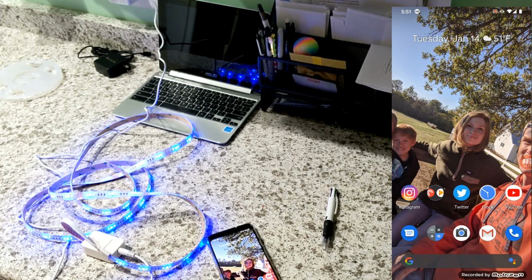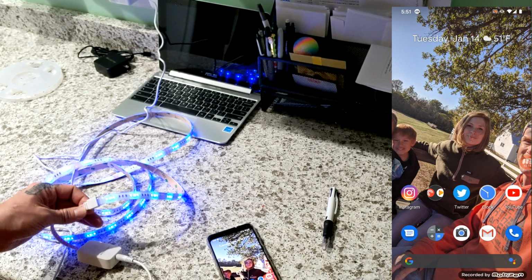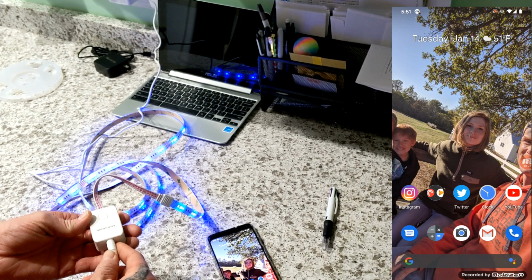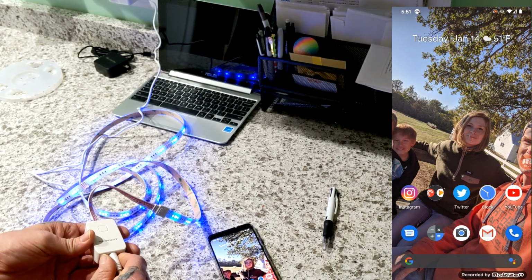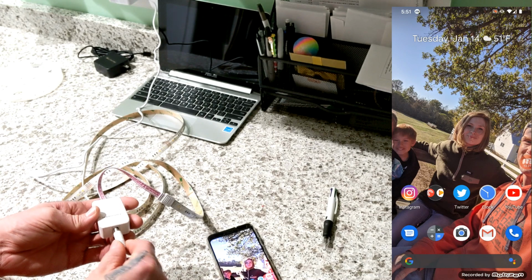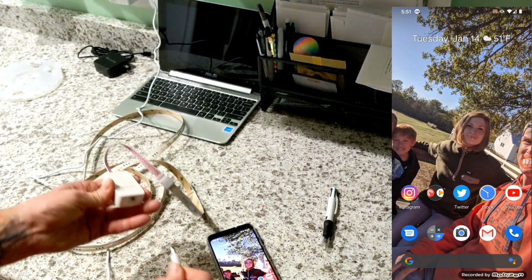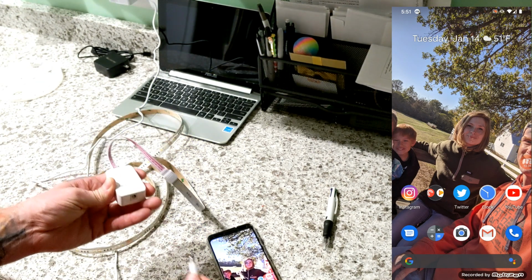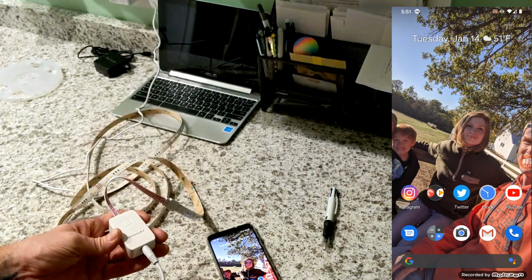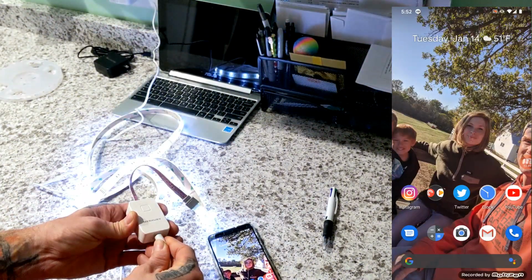So there you go. That's the setup process. You can also just go into the Geeni app. I'm not sure how well voice commands work with iPhone. You can always go into the Geeni app and control your smart LED strip that way. Just another example, if you need to reset this strip, you can disconnect and reconnect 3 times. It will go into a pairing mode again, if you need to maybe forget a device or set it up as a new device later on.